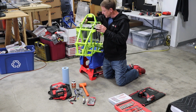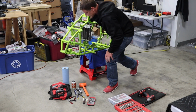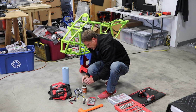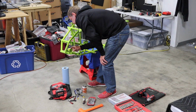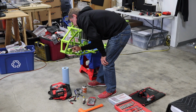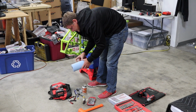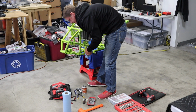So, once I get this stuff on, now what I'll do is the steering stem. I'm going to go through this. First thing I'll do is take anti-seize and put it around the cup. All inside the cup, so that bearing doesn't want to seize up in there. And again, with the race bikes, I take them apart enough that it's never really been an issue. But I just use it anyway. Makes stuff slide out easier when you want to knock it out.